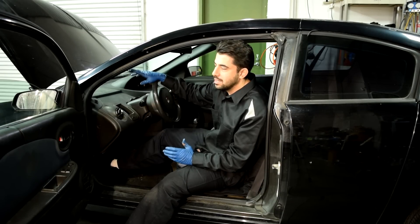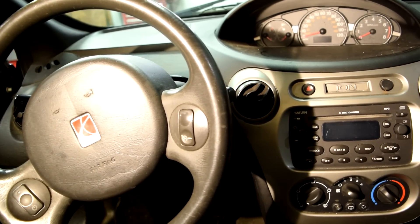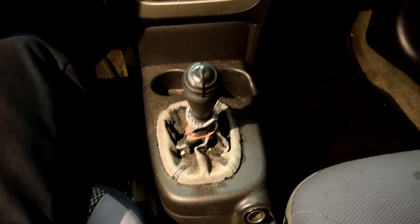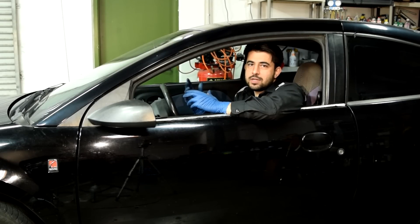Here's how you can tell whether your clutch is slipping. Get in your car, start the engine, and apply your emergency parking brake. With your foot on the brake pedal, put the car in first gear and then suddenly and quickly let go of your clutch pedal. If your car jolts forward and your engine stalls, then you do not have a slipping clutch. But if your car does not jolt forward — maybe moves a little bit and the engine just keeps going — then your clutch is indeed slipping.